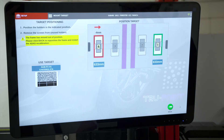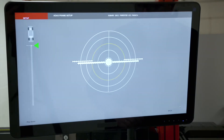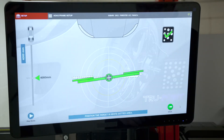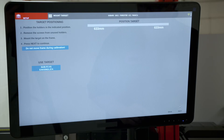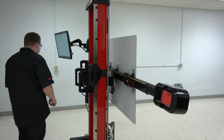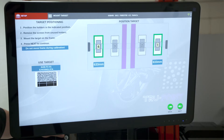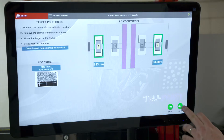It looks like the frame moved out of position when I put the target on. One of the key points of the TruePoint system is that it's always measuring and tracking where it is in 3D space. We need to hit the back button and double-check our adjustments on the frame. Going back to the front camera screen, the target is still in the green, so that's okay. It looks like putting the target on moved one of the brackets out slightly — we need to move it four millimeters in. Now that the target is correctly positioned, we'll hit Next.